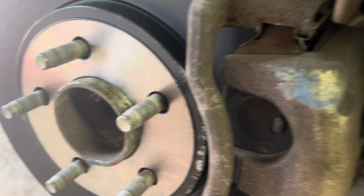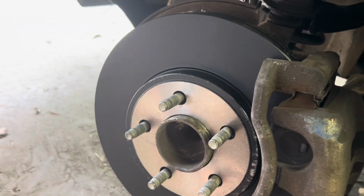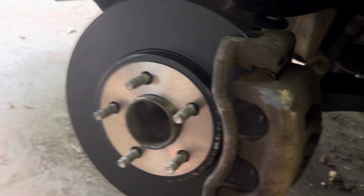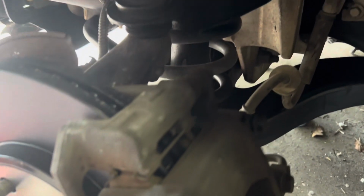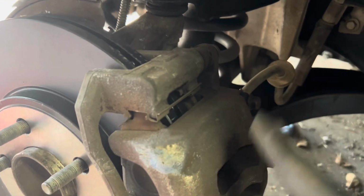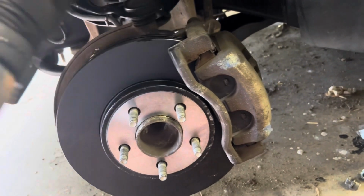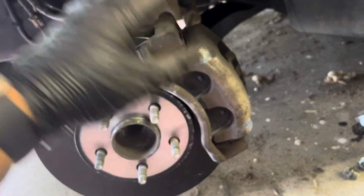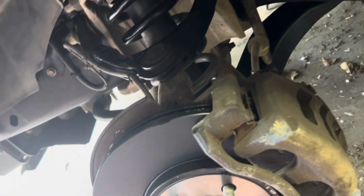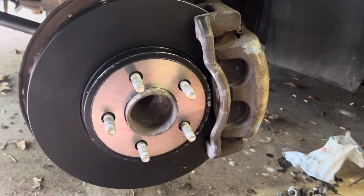Now, once these are screwed in place, we're going to whip out our torque wrench again. And the appropriate setting for your caliper bolts is 27 foot-pounds of torque. Once again, 27 foot-pounds of torque. Let's go ahead and knock that out. All right, guys, and here's your finishing results. Bracket, caliper, rotors installed. 118 foot-pounds bracket, 27 foot-pounds caliper bolt, and now your front brakes are finished.